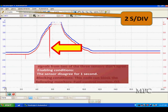It would definitely, if we stayed there a little bit longer, cause a problem between the two where the plausibility check would say: they don't agree, I don't know what this is, I'm not sure this is a valid number. And the PCM could go into a failure mode.